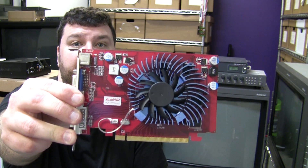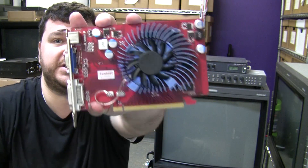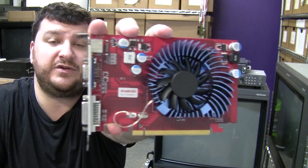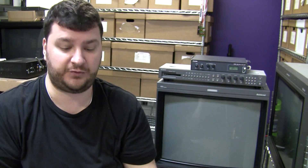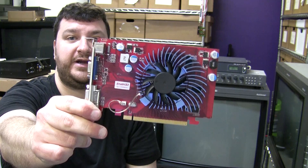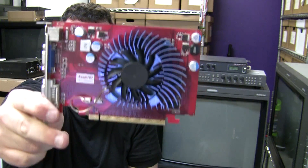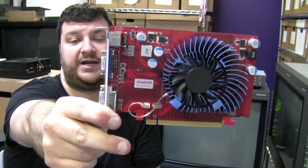One last option is to just install a video card that outputs RGB 240p natively. I like to use arcade VGA cards because they're pretty simple — all you have to do is install them, run the software, and that's it. Even directly on boot through the DOS screens, it outputs 240p. A lot of arcade enthusiasts don't like these because they're very expensive, and you could accomplish the same thing with some standard ATI video cards that you can get for about $20. My suggestion is if you're a PC nerd and don't mind a little tinkering to get a basic VGA card working, just do that and save some money. But if you'd rather just plug something in, load some drivers, and reboot, then the arcade VGA card is the one for you. Let's take a look at how it works and how it looks on screen.